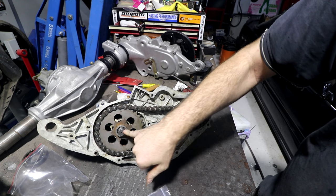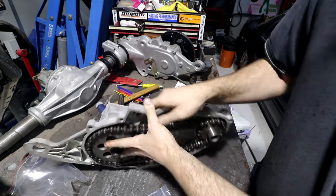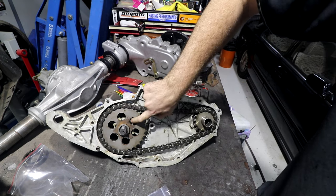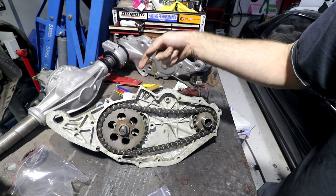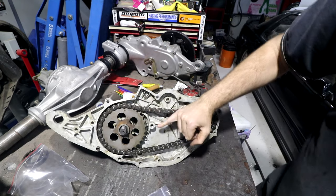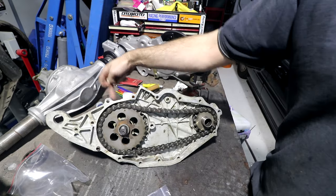The next thing, there's a nut that holds this on. One thing that you could miss is this whole section, where we're thinking about keeping oil out of here. So the oil comes to here, it can't get down this edge here because the outside of the seal is blocking it. And it can't get through under the gear and down the inside of the shaft because the inside of the lip seal is blocking it. However, oil can get through these threads, down through the spline, and then into this side of the gearbox.